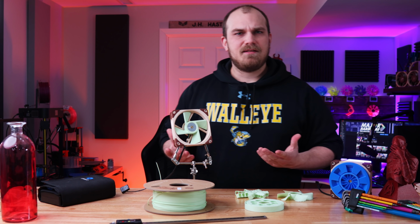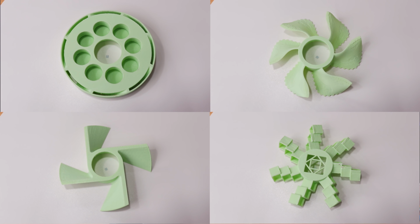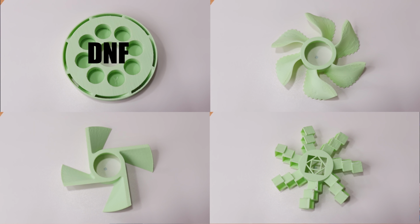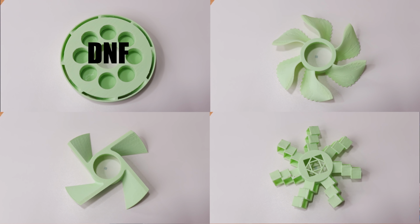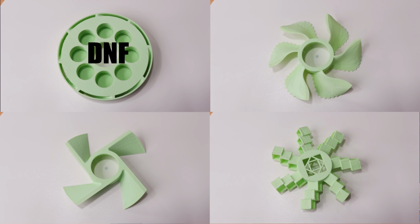But was all that noise put to good use? The disc fan was the quietest, but it also performed quite poorly and got a good old DNF, as it thermally throttled within about 8 minutes of starting the cooling test. So, unfortunate. The loudest possible came in with an average temperature of 75.5 at a room temperature of 20.8, giving it a delta of 54.7.